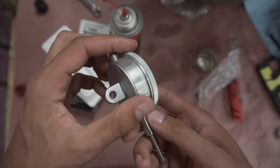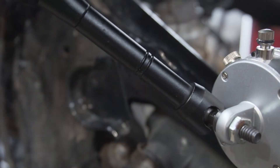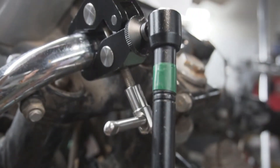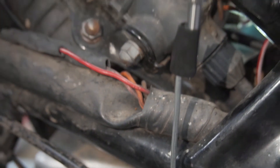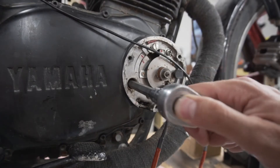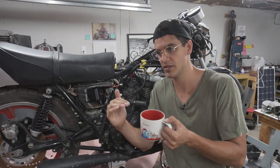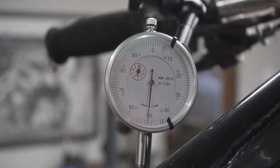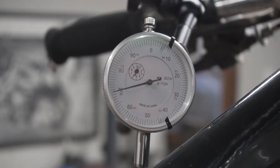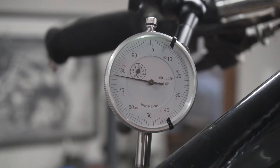So I got the dial indicator out and I got it hooked up to a magic arm, which is a pretty cool little articulating arm. It'll help you hold things in space exactly where you want them. The little feeler stick post on the bottom of the dial indicator wasn't long enough, so I just taped a piece of aluminum wire to it, which was pretty accurate. I stuck that aluminum wire down into the spark plug hole, and then I turned the motor over a couple of times trying to get that piston to the exact top dead center — so the piston's pushing up on the aluminum wire. As the dial goes up, the piston's coming all the way up, and then when the dial stops, that's when the piston's at top dead center.